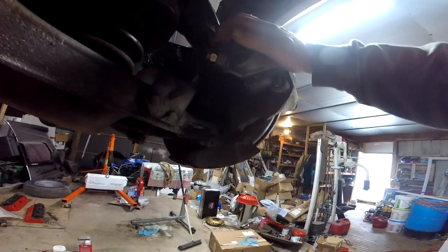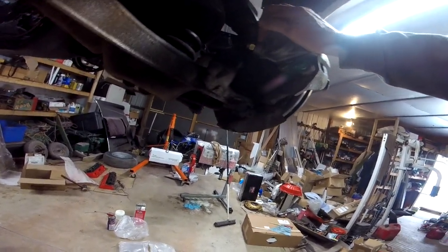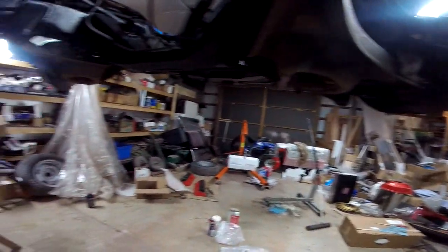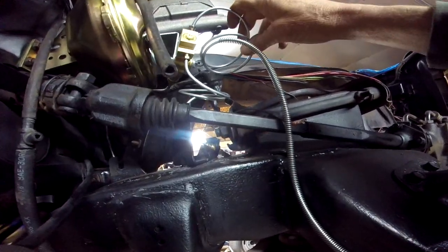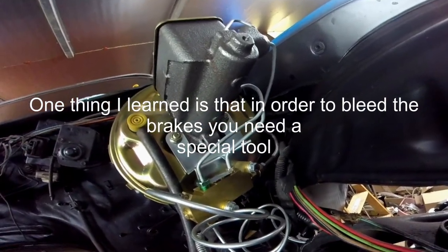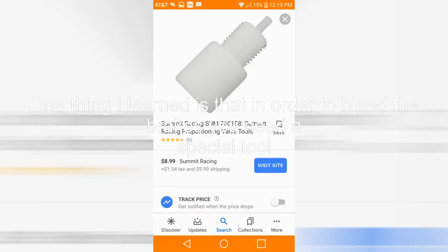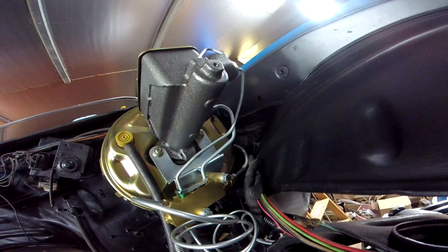So I got this leak taken care of, like I mentioned in a previous clip. I had to take a die grinder to smooth out the face of the caliper, which was never machined. Luckily, I got that. We got our new crossover line here with the little protector, I don't know, just to keep it factory. Put the little piggy tails on there. It's kind of like, I don't know if it's exactly like original, but and we got our proportioning valve and everything is as it should be, I suppose.